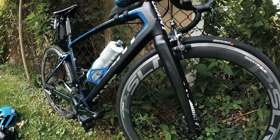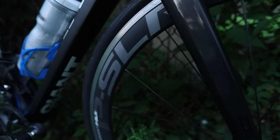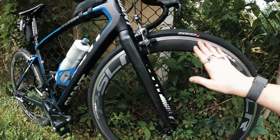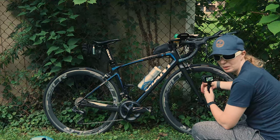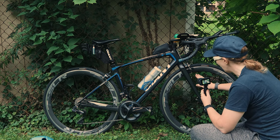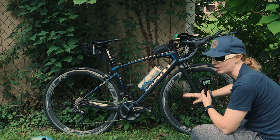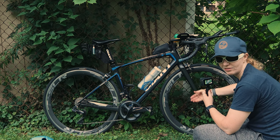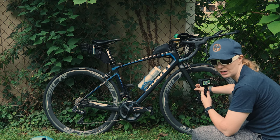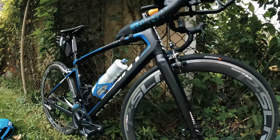Starting from the bottom, I'm using a pair of training wheels — aluminum with a carbon fairing, so I still get an aerodynamic benefit without putting my light carbon wheels at risk on unknown roads. The aluminum braking surface gives me extra stopping confidence with riders I don't know. Before you lecture me about disc brakes — I like rim brakes for my use cases. They're no-fuss, easy to maintain, no bleeding, no noise. I'll buy a disc brake bike in the future, but rim brakes are more than good enough for me here.